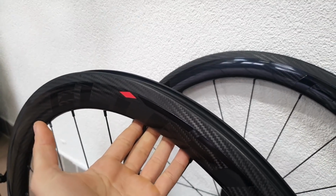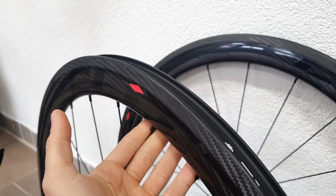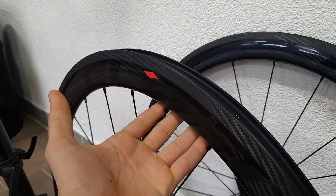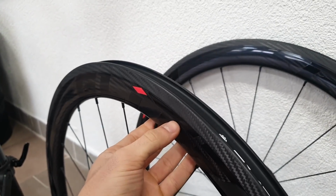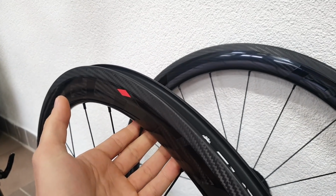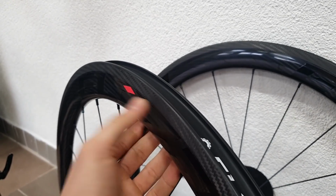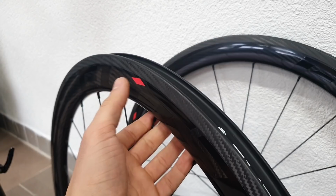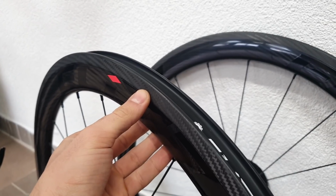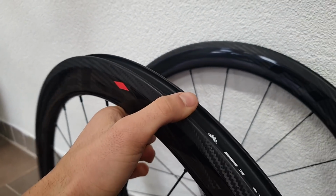As for the safety concerns, I think they can be even more pronounced than with the frame. It also comes with tubeless tape, this pair, so I really wouldn't risk that even on my worst days, because at least with the clincher you have a tube to keep things in check. With tubeless and rim brakes and cheap carbon, it's a really disastrous combination. So if you are contemplating something like this, at least have them in the disc brake version, and preferably tubular, because there are far fewer things to go wrong there.